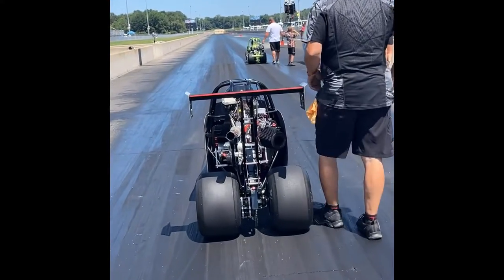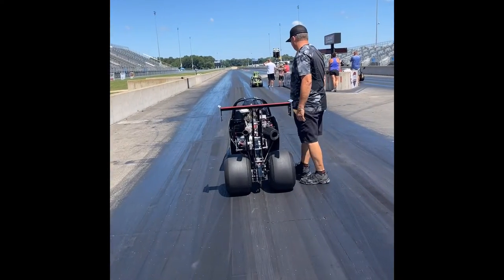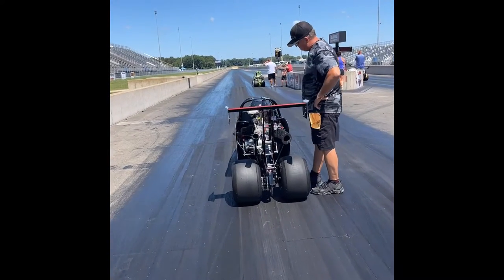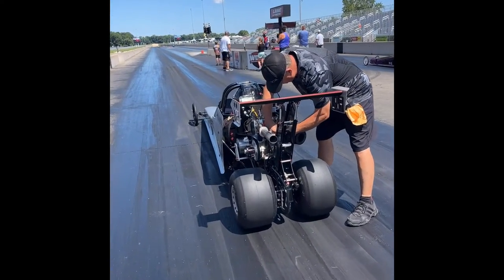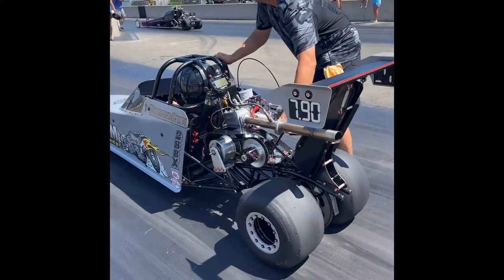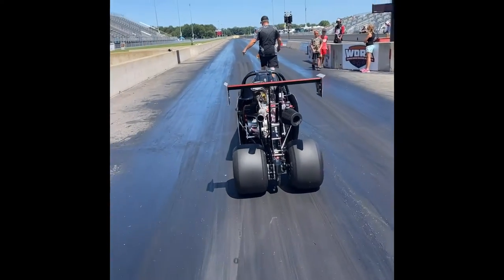The pilot of this car is Danica Cox. Same procedure here — no burnouts. We wrap our tires; the wraps are all in one. This car also has a lean-out valve. You'll see him make a quick little move when he gets up to the front — he shuts that lean-out valve off just before he stages the car. So I'll let you guys watch this, we'll be right back.